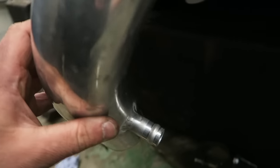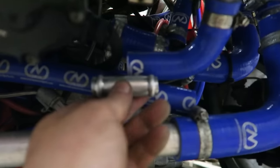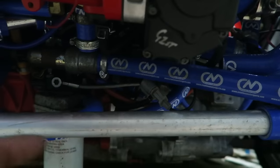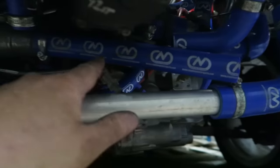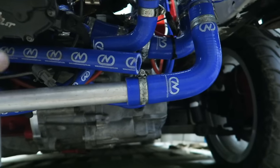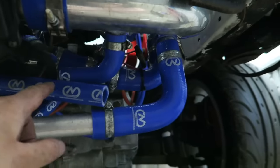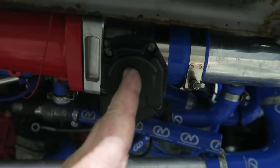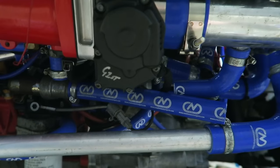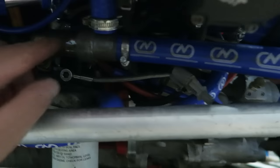So I've got the take-off welded onto the pipe now so I can whack that up there. The throttle plate goes in the middle and what this does is it just allows a bit of air to bleed through from this side and then back into the inlet manifold. On full boost, when this is open, it can't really leak anywhere because the pressure on both sides is the same. But on idle, when this is closed, because the OBD2 throttle body doesn't have an idle screw, you can't manually adjust it. So instead you're just allowing this to bypass it so this can control the air.